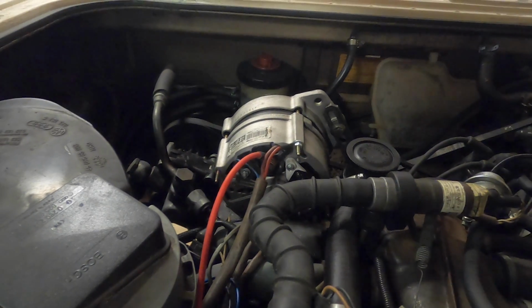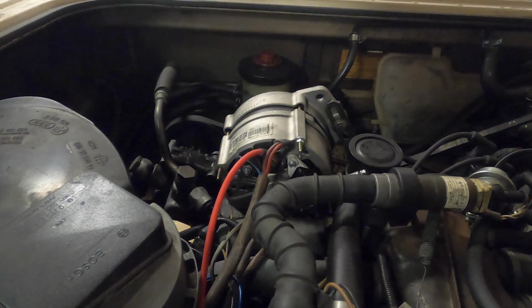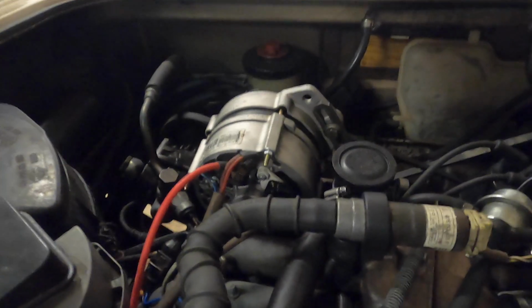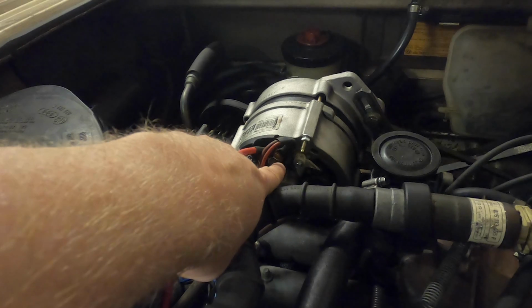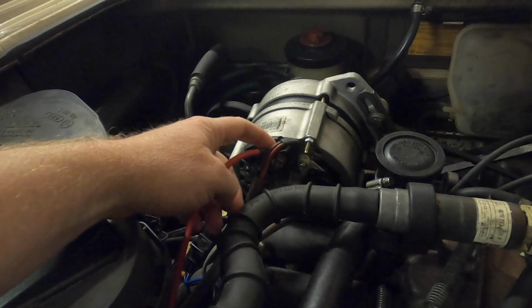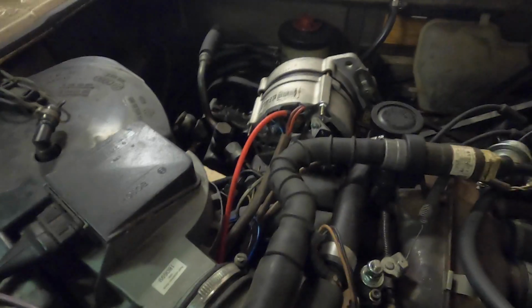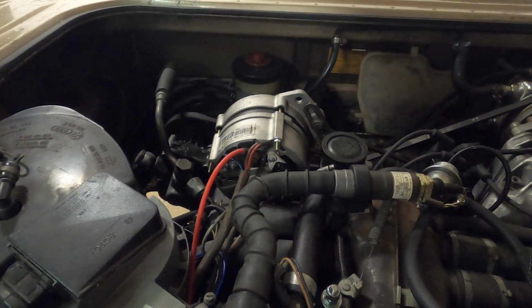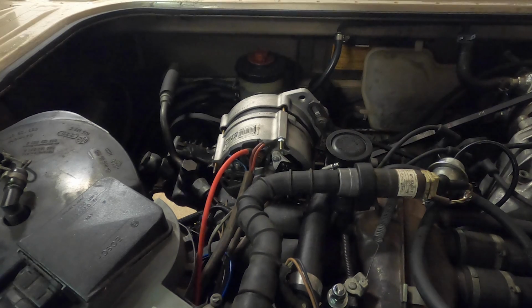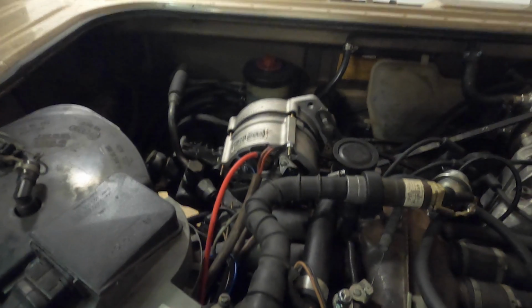Now, when you install it, you want to make sure that the negative battery cable on the starting battery is disconnected. You don't want any kind of power coming through the system while you're doing this. Basically, you take a wrench and undo that nut, and then put one end of the cable onto the post as well as your original OEM stuff here. And then same thing for your starter. Where the positive battery cable comes in onto the starter, you disconnect that nut and you put the other end of this wire on it and cinch it all back up.